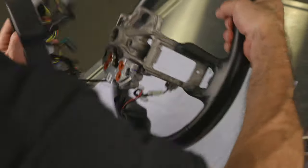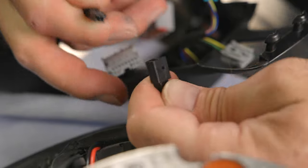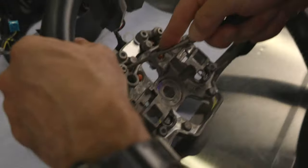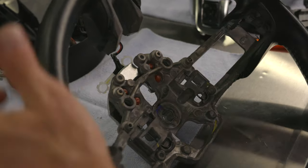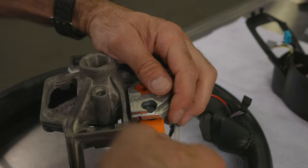There's still one more connector to disconnect before we can pull the rear shell off. Once off, set the rear assembly aside. All that's left to remove is the steering wheel dampener. Using the pin punch, carefully push the four orange rubber grommets holding onto the steering wheel dampener. Be careful and gentle as you don't want to tear into the grommets. With the plastic pry bar you can then pop off the dampener.